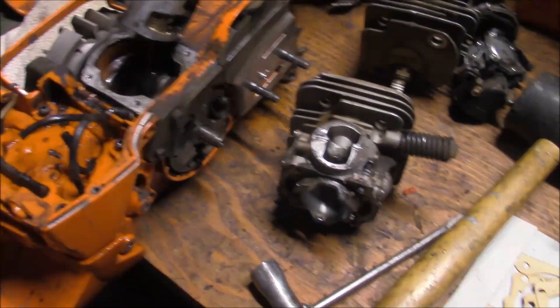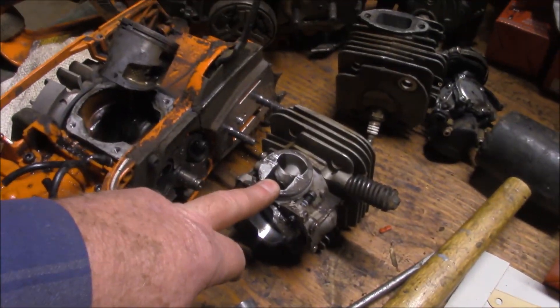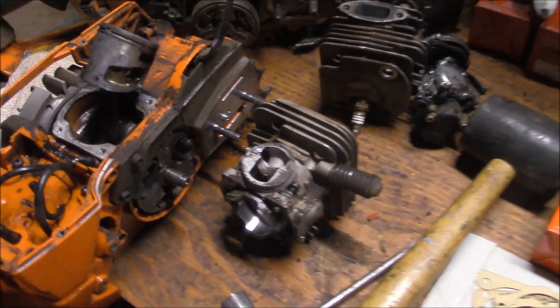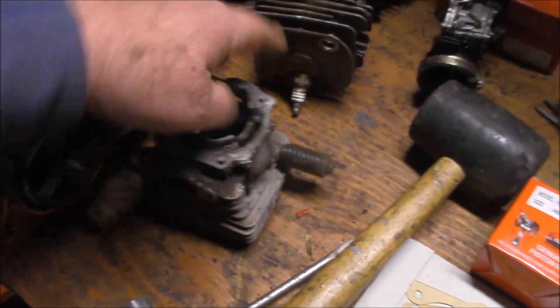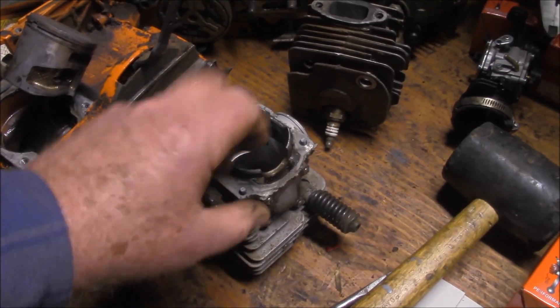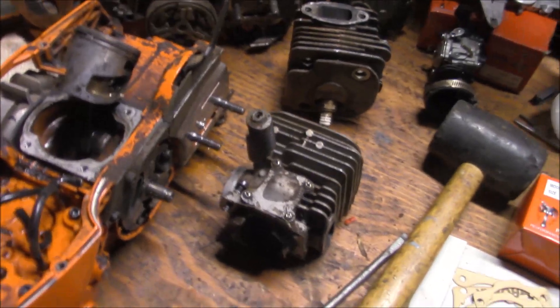And then on the X-Torq, I've done this modification where basically I gut the intake — the filter holder, intake boot, the intake port, and stuff like that. And then, as I said before, I cut the skirts and I radius the bottoms of the transfers. It makes a huge difference when you get the squish down to about 20 thousandths.